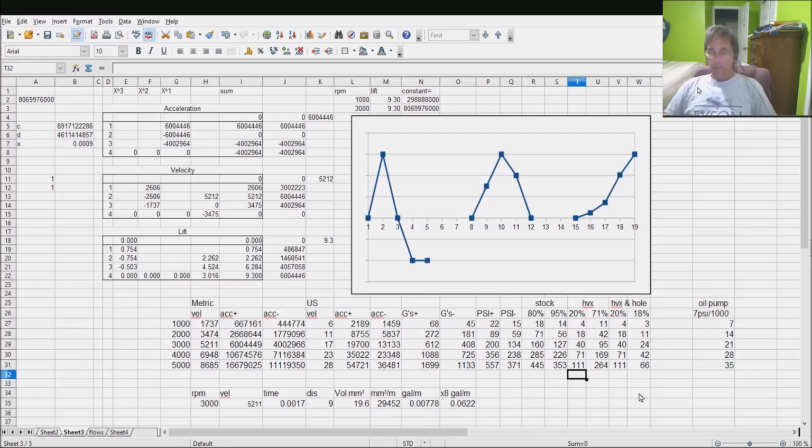I want you to look real quick at these values right there, and those are absolutely horrible oil pressures. However, if you've put that particular modification with the ring around the rocker arm, and you boost this up by about a factor of 10, that's actually better than stock, which means that you can get away with poking a hole in the top end, this part right there, and you won't fry your rocker arm with a bunch of galling.